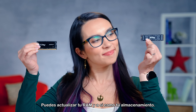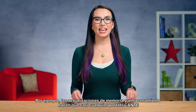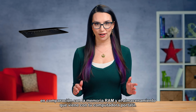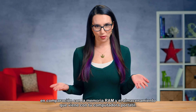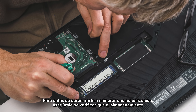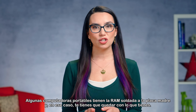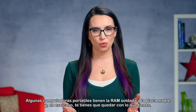You could upgrade your RAM as well as storage. Memory and storage upgrades make almost any laptop sing when compared to the RAM and storage that come stock with your laptop. But before rushing out to purchase an upgrade, make sure to check that your laptop's storage and memory are upgradeable in the first place. Some laptops will have RAM soldered to the motherboard and in that case, you're stuck with what you got.